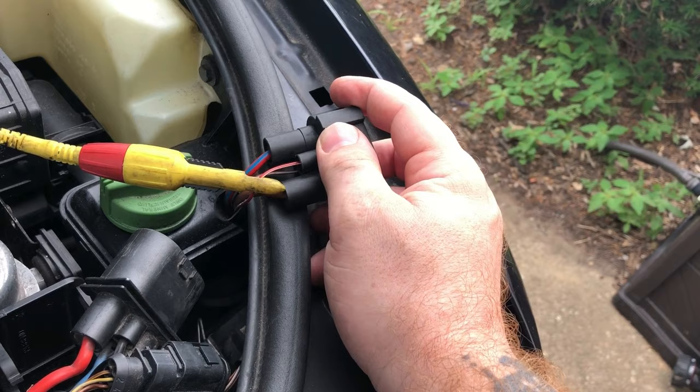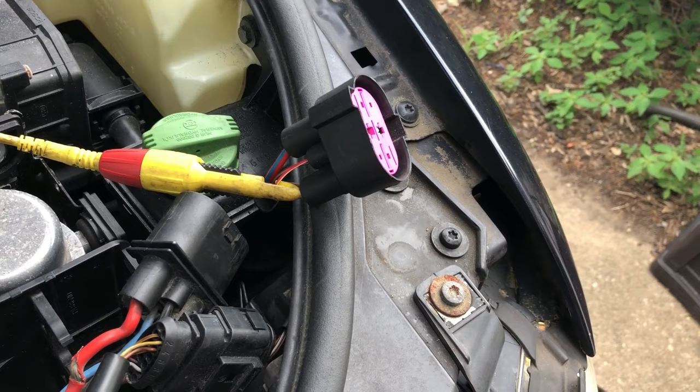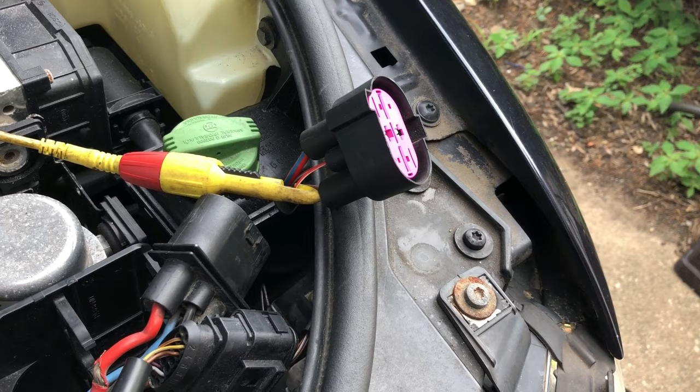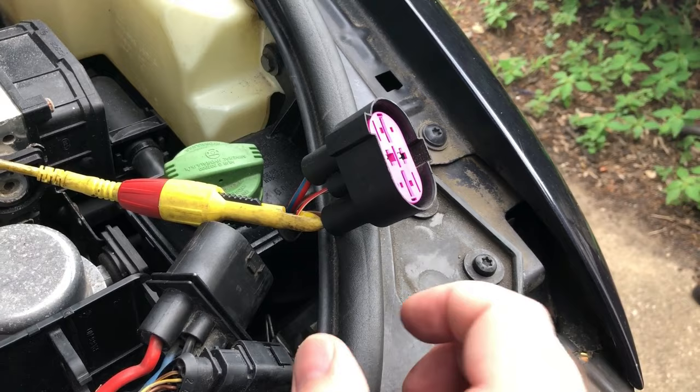So how can I test this? The easiest way would be to find some way to disconnect this wire, plug everything back in, and if the cooling fan stays running, we know we have a problem with the cooling fan control module. If the fan shuts off, then the problem has to be somewhere else — like an ECM drop in communication, transmission control module drop in communication, or maybe a sensor shorting out. This will be the first easiest test to give us a direction to go in.